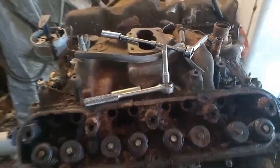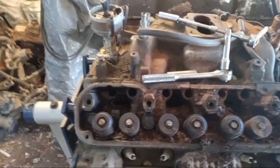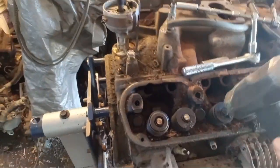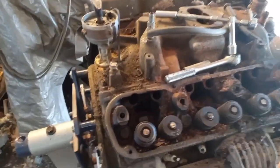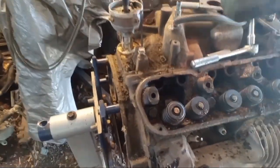Let's grab my favorite whacker tool and take a whack at them - we're not going to try to break them like old Mortsky did on that one flathead. You can hear them springing back. If they weren't springing back, it would be a more solid sound, and you can feel the spring back too. They're all springing back, so we don't have a stuck valve over here.